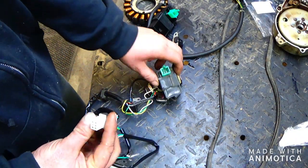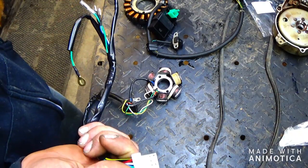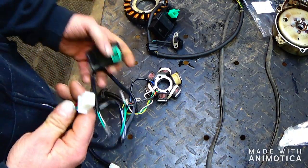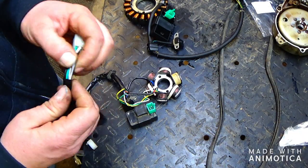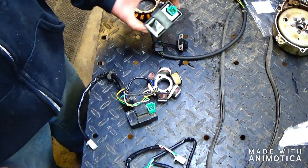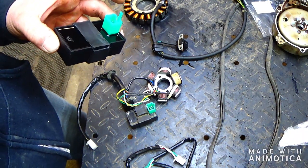You can wire these any way you want, but the way I do it is I buy a little test wiring harness for like a pit bike. The five pin clicks in there, and the four pin — the only difference is the four pin does not have the black and white kill switch wire, so with that you would have to hook it up to the key switch or to the kill switch on the handlebars.